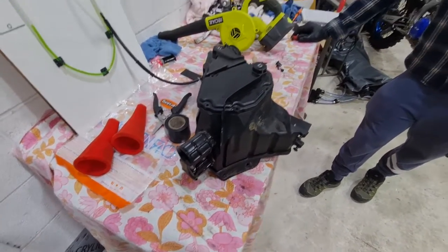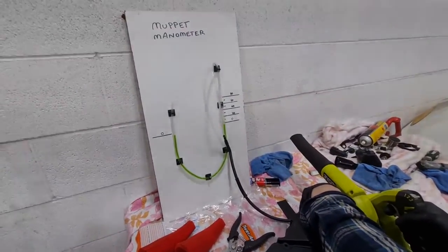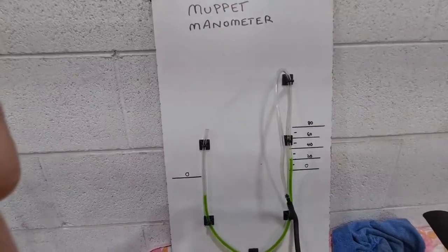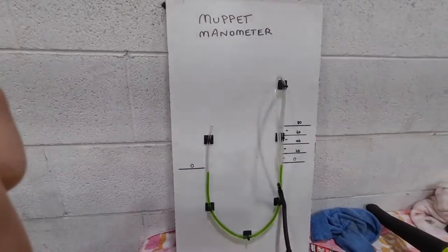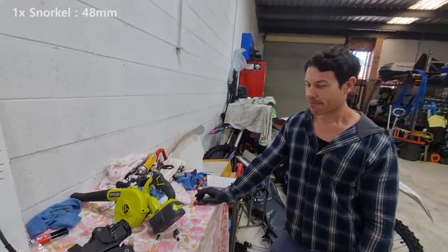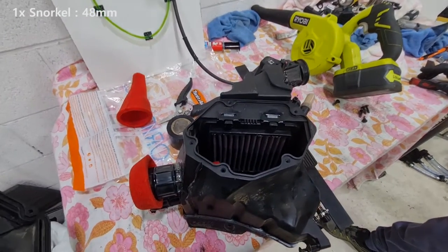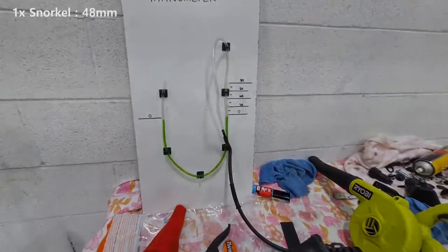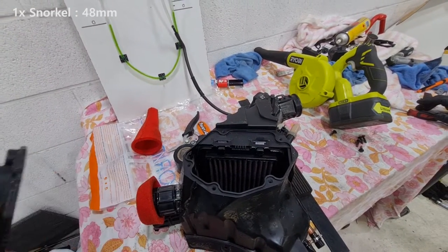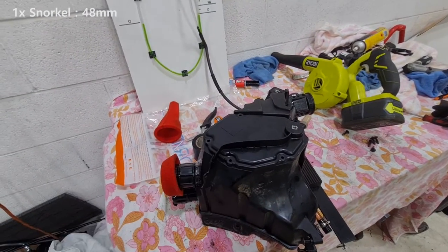No unifilters — we're going to leave those out. Aaron, what have we got? It's going high — just a lick under 50, so about 48 millimeters of water. Aaron mentioned something quite interesting: on the DNA website they say this is 10% better flow than the OEM one, and based on our measurements and Aaron's tests with the OEM air filter, they're spot on. DNA actually do their airflow testing — believe it or not, an air filter company. So yeah, spot on, 10% better performance than OEM.